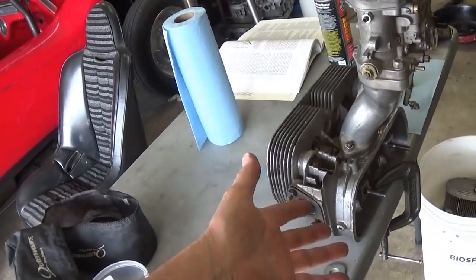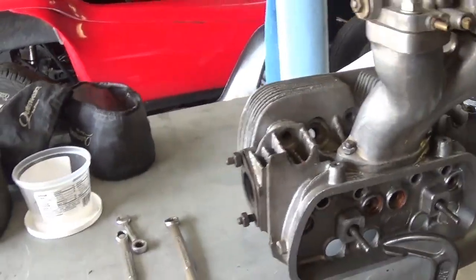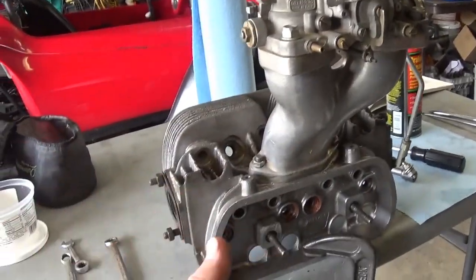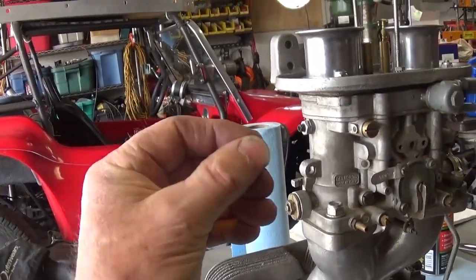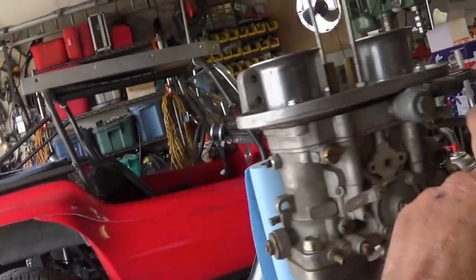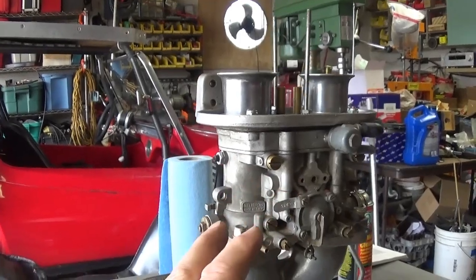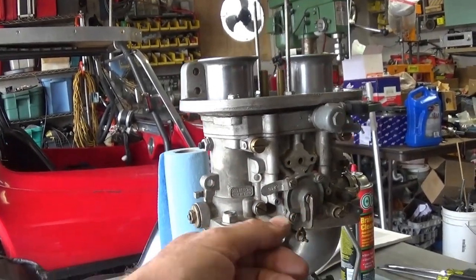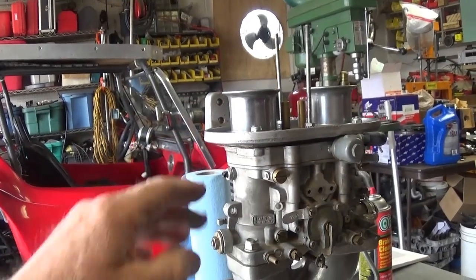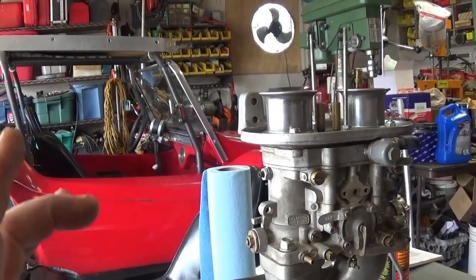And I had this old Magnum 44 head that is now junk, because that's the one that lost the valve guide. And I found that, hey, I've got my table here. I can just sit down and I can enjoy this process. What I did was take this carburetor and hold it in my hand and connect it to the fuel line in the normal spot. I put a little cap on this right here and I let it run and I let it fill. And I operated the throttle until I saw the accelerator pumps squirting, and it was a nice smooth flow.